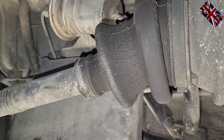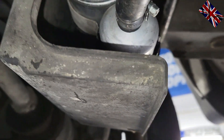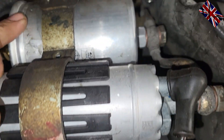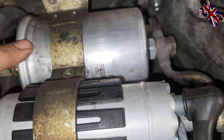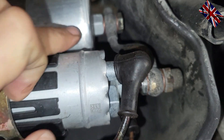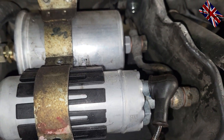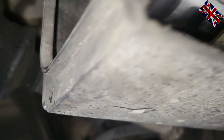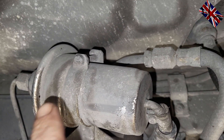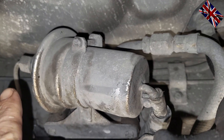The car is already up on the lift. We are right at the assembly behind the rear axle on the right-hand side of the vehicle. Only one pump is needed for six-cylinder models. Below is the pump, on top is the filter. This is the high-pressure fuel line leading to the accumulator, which is situated outside this protective plastic shield — right above the drivetrain from differential to the wheel. This here is the inlet: incoming fuel passing through the accumulator, exiting it towards the engine bay.